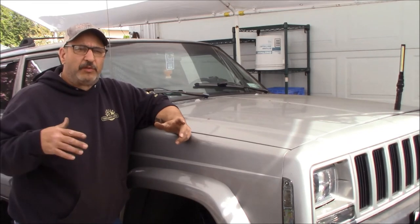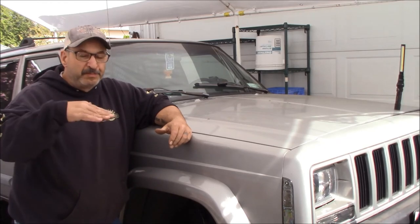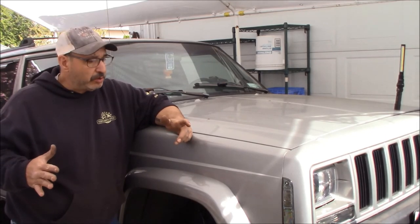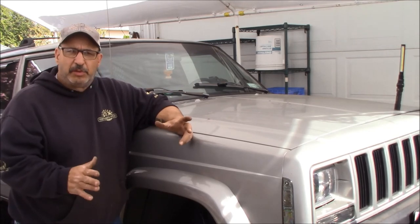We got those springs in relatively easily because we had everything disconnected, and they are a half inch longer — they still went in relatively easy. If you had a three-inch lift spring you might need spring compressors, but that wasn't the case here. We were going for stock height; the car did have a slight rake to it so I'm hoping these springs will even it out. The old springs were original — 22 years old, 134,000 miles, and heavily pitted and rusted, just like everything else in this thing. I'll link the springs in the description below along with the entire playlist for this front end build. That's it for coil springs on the XJ. To take them out I did the same thing — went in with a pry bar and popped them out once you jack up the opposite end of the axle. I hope you enjoyed the video, thanks a lot.